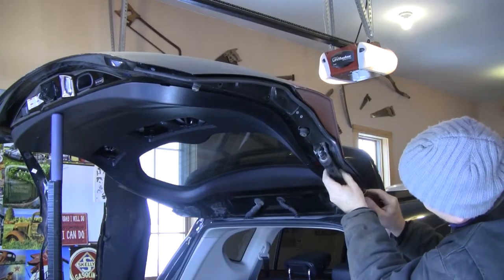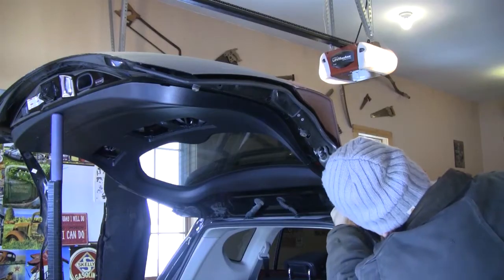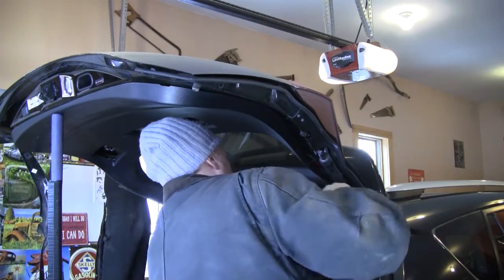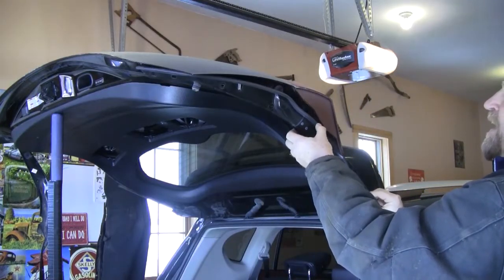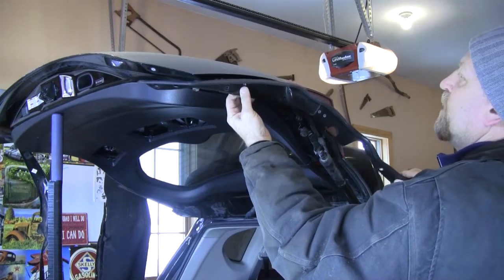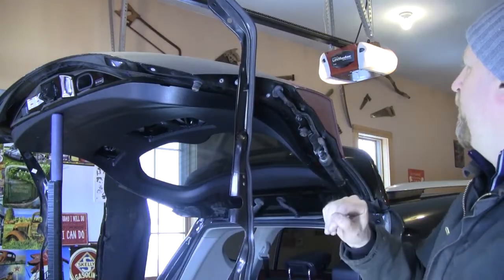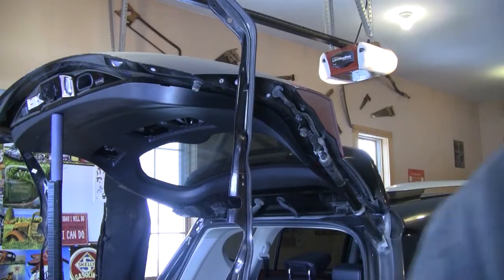There's one bolt right here and another one right here. I'm going to pull this — the whole piece is going to want to come down on me. There we go. Just pull this out. It's wired up inside there, so we'll pull that wire gently just to get a little clearance. It's all still attached, so that trim piece is just going to stay. We're not going to pull on it very hard. Now let's move on to the strut and show how to get that off.